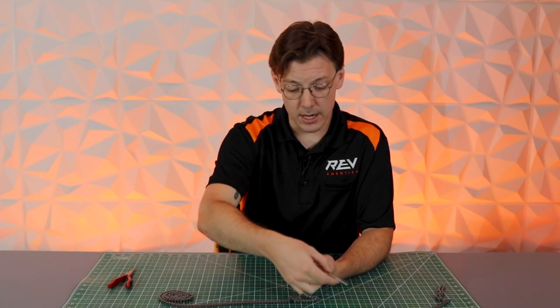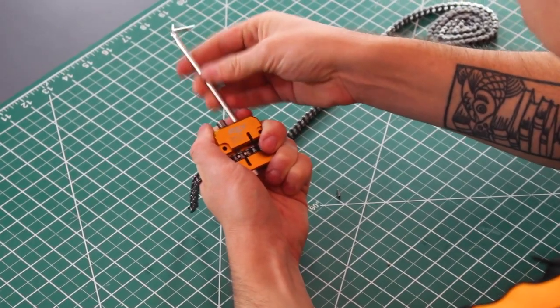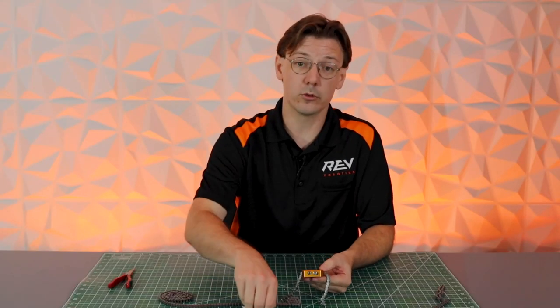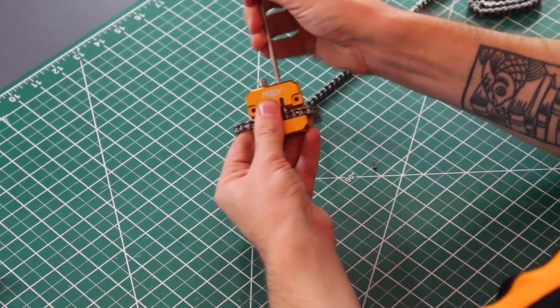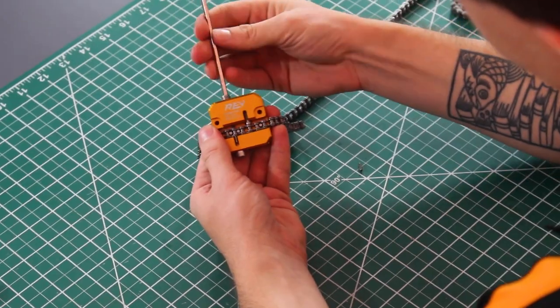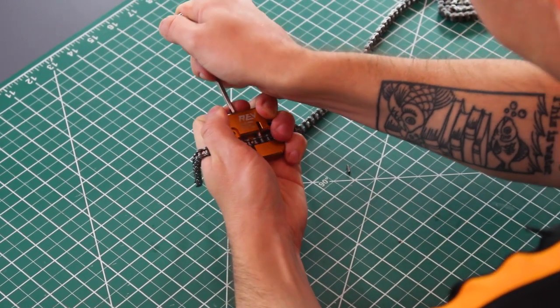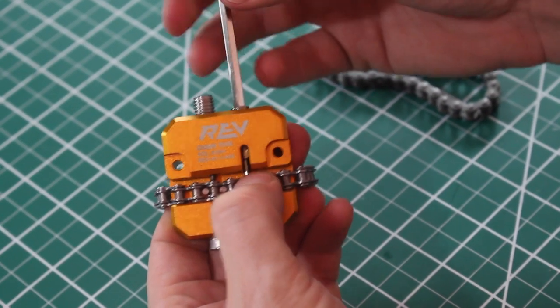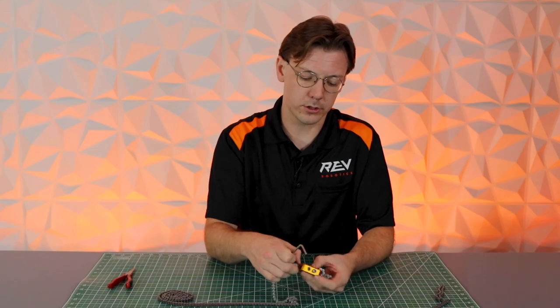If this is your first time doing this, it might take a few rounds — back driving the pin screw, undoing the compression set screw, and checking to see if the chain has actually been broken. Sometimes it does not break and you need to redo those same steps by placing the chain back in, re-screwing down the compression screw, and continuing to move the pin through. Feel free to take your time, because getting it right the first time is better than having to keep trying again and again.